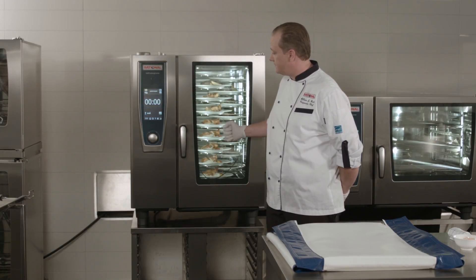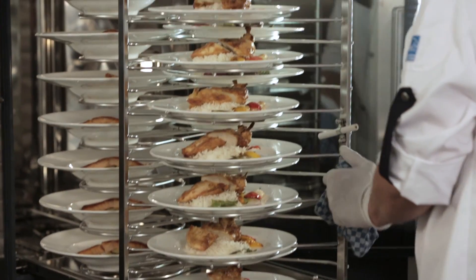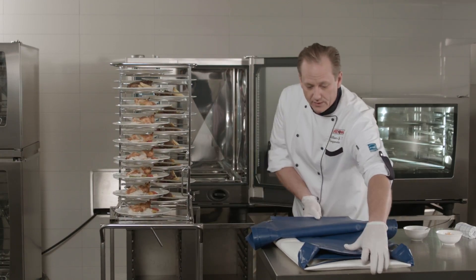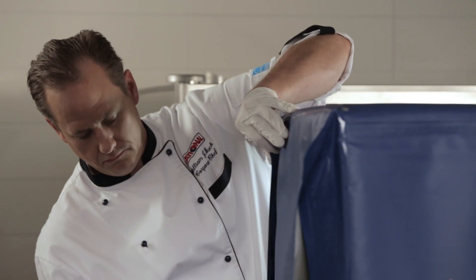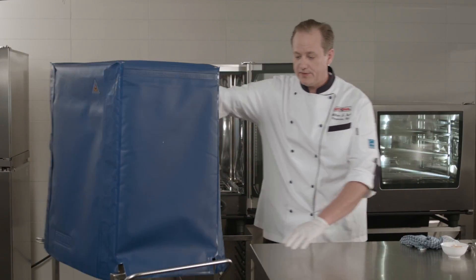The self-cooking center is done. You can see that I have my zeros on the screen and the light's flashing on the internal cabinet to tell me we're ready to remove it. I'll pop open the door and remove the plate. When you have the first trolley removed, you can select the new load button and insert the next trolley — you can do this up to four times per service period. After the trolleys are removed, place your thermal cover onto the racks, folding down all four panels to make sure it's good and closed. Now you have a passive holding system for up to 20 minutes.